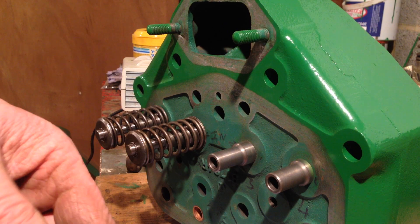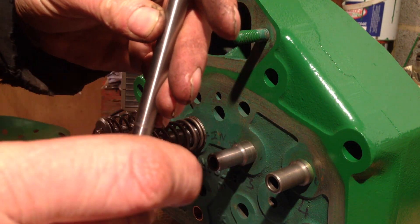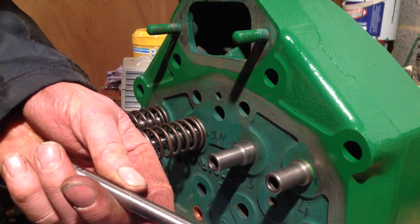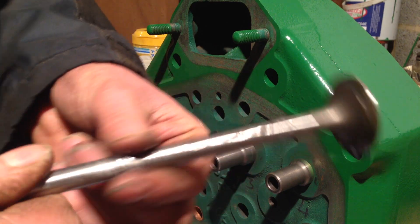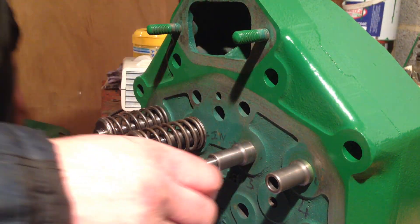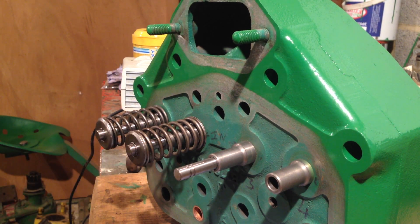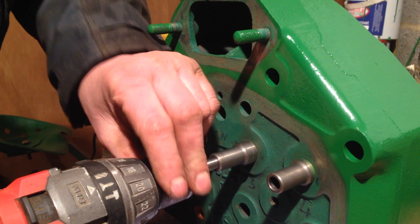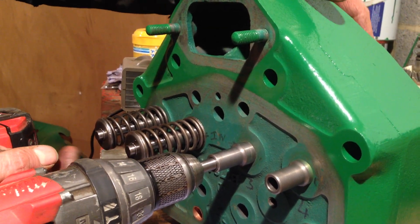So I'm just putting a little bit of grinding compound on - grinding paste, sorry. I'm sure a lot of you have done this before, it's not rocket science. A bit of oil on the old valve stem, put it in from behind - well, the stem comes through. You could just hear that slight grindy noise, so that's the valve grinding compound working. I have a slightly different take on doing this - I'm using my drill just to go gently one way and the other.